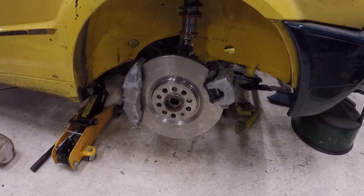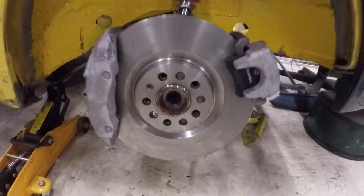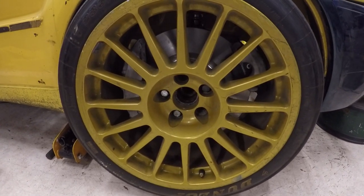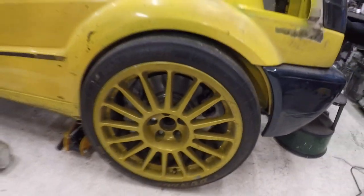First test on the car - looking good. Final check with the wheel back on and it's all looking good. Overall I'm happy with that. What I'll probably do now is get a set made up in slightly thicker steel - what's on there currently is about 5mm thick, which I don't think is quite enough. I'm going to go to 10mm or 15mm just to ensure there's no flex at all in that caliper mounting. That's it for this video - thanks for watching, see you in the next one.